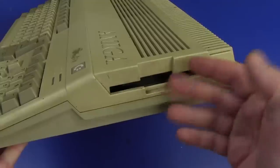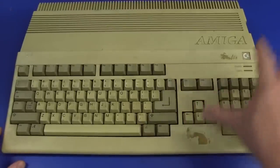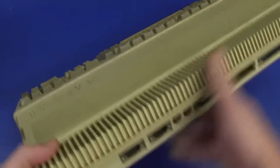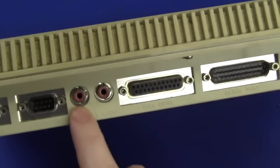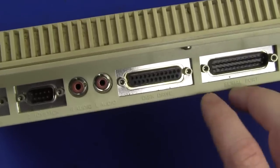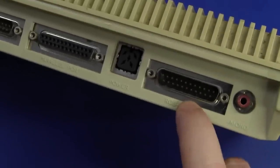We have a built-in 3.5-inch floppy disk drive — not that 5.25-inch rubbish — state-of-the-art for 1987. It can read and write IBM disks, Mac disks, and all sorts of stuff because the controller isn't fixed to one particular disk format. It had a separate numeric keypad and separate cursor keys, which was a huge professional feature back in those days. We've got two 9-pin joystick interfaces, left and right audio. It actually had 4-channel audio — 8-bit audio at around 20-something kilohertz sample rate — four independent PWM channels, so quite advanced audio capability for its day. There's also a disk drive interface, serial port, 25-way parallel port, power input, RGB video output, and composite monochrome output as well.